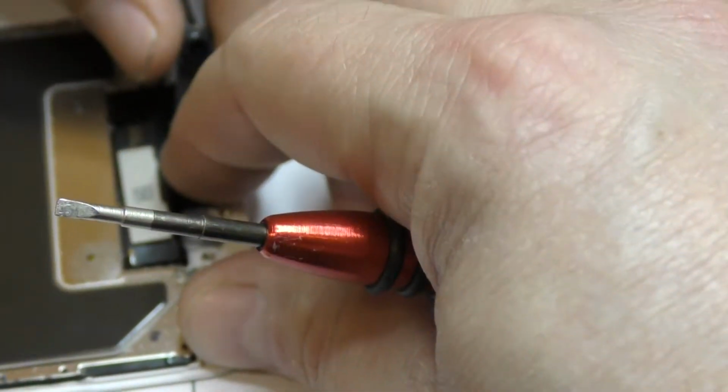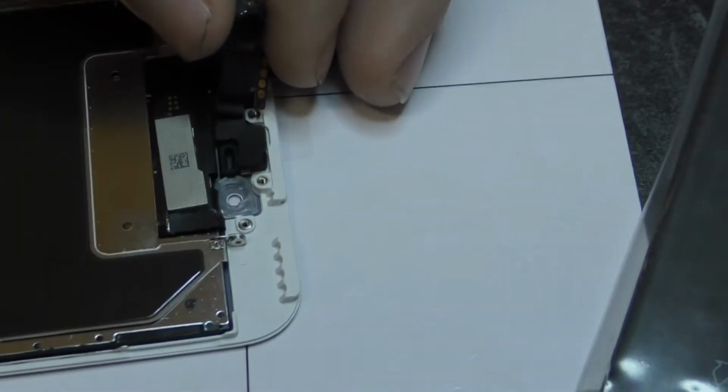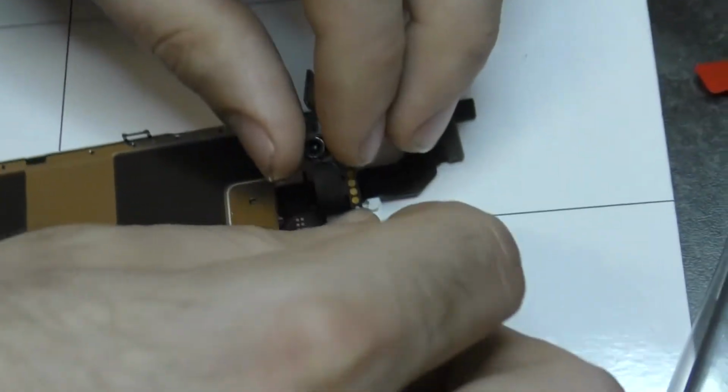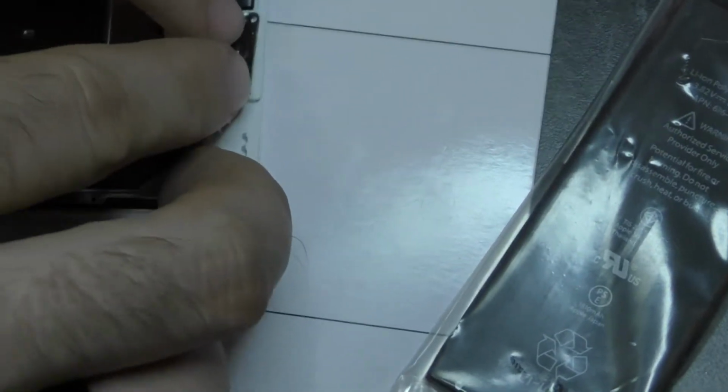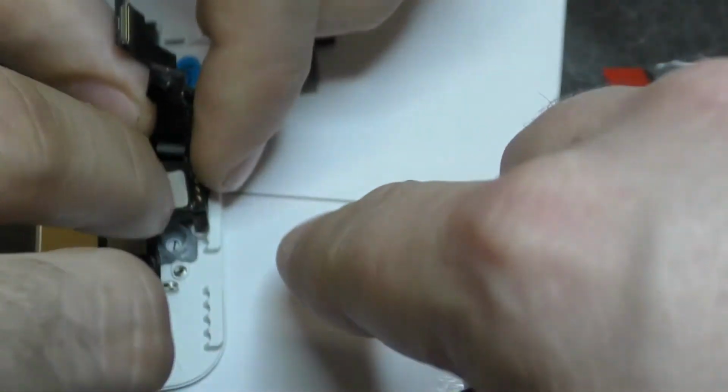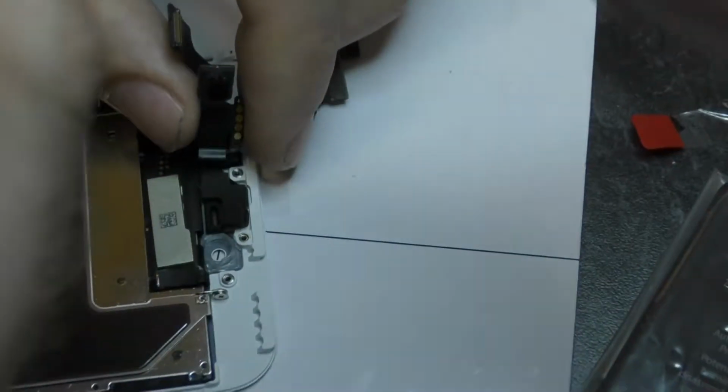We're going to keep our camera back, and then we're going to line up our front sensor. And we're just going to use our finger to feel. You'll know when it goes down in there when it feels like that. I know you can't feel it on camera, but if it feels rigid, it's not in there properly. Nope. That's right. Now we got to put our speaker in. Pull that camera back up. You should feel the speaker sink into that rubber cavity because you got that little block on the back side.